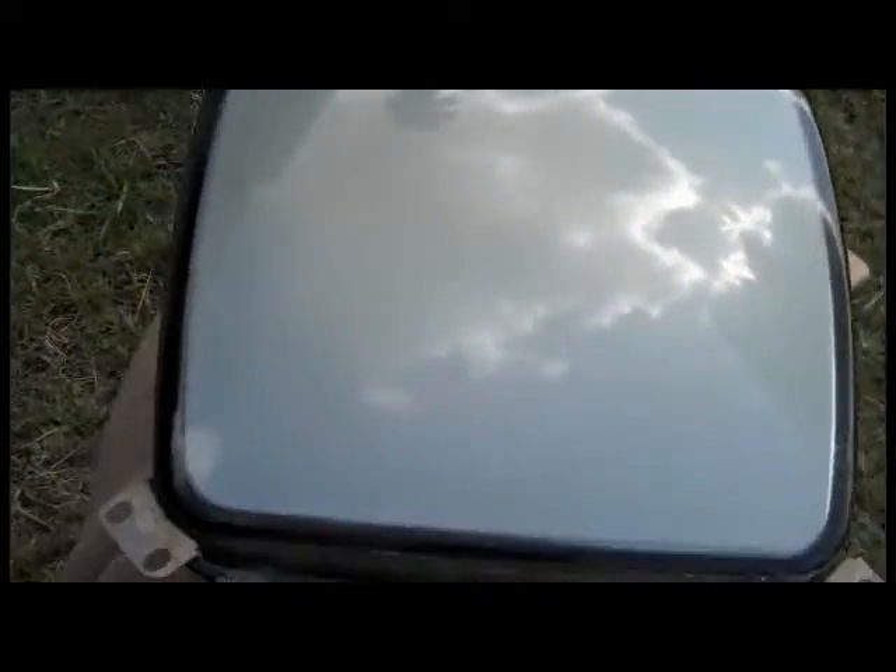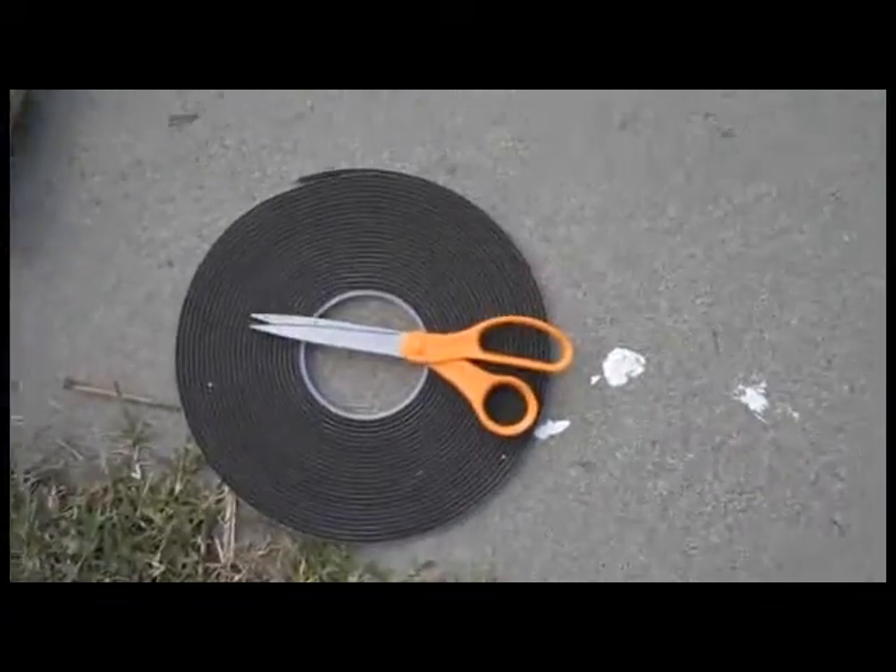This has got to be spotless. After an hour of cleaning we're ready to go together. I'm doing this in the yard so if I drop any of it hopefully it won't break. First thing I'm going to do is put some double-sided tape around the edge to act as a spacer and padding. I put some double stick tape on here right along the edge. Next I'm going to go over this and double clean it because once you put it together the dirt is going to be sealed in there forever. Then once I get it on there and lined up I'm going to run a bead of silicone around the outside to make it airtight.